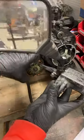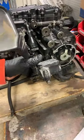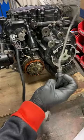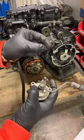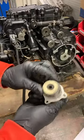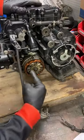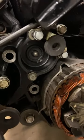So what I have here, from the handlebar, from the left-hand side, this is your clutch. This is a hydraulic clutch where some hydraulic fluid is running inside this steel tubing. The clutch lever squeezes a tiny amount of liquid down this line to the end, and a small push rod here. That small push rod is pushing another push rod. That's the push rod.